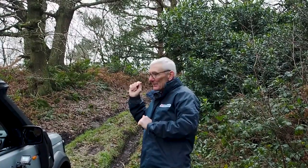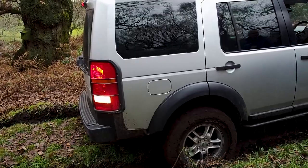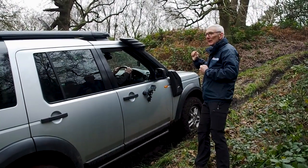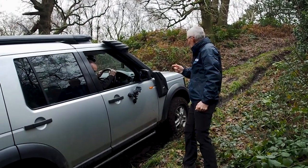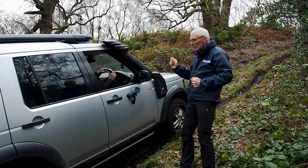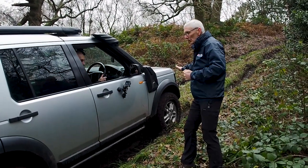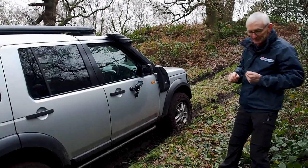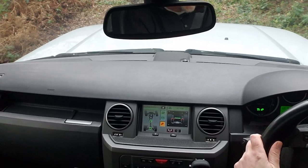When you're ready, into reverse - hill descent will be on. Feet off all the pedals and let the vehicle go back. Most people find this next bit very hard - they want to cover the brake. But if you're touching the brake it deactivates hill descent control and you take over, braking all four wheels together. Hill descent control will brake each wheel independently, allowing the vehicle to go back and giving you steering - more importantly, to go back where you need to be. Know where your wheels are - you've got the in-cab graphics and your steering wheel helping you. Foot's going off, keeping it completely away. I can feel it's gradually taking me back down the hill in a controlled way.